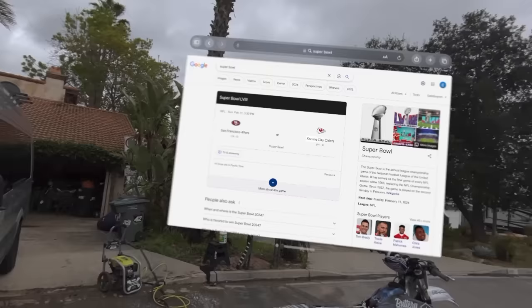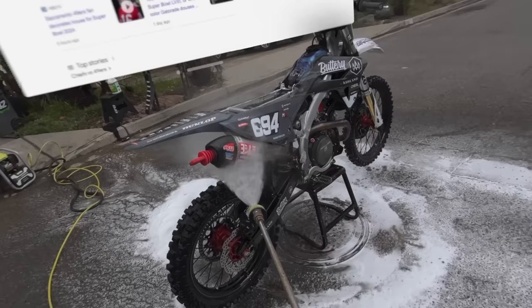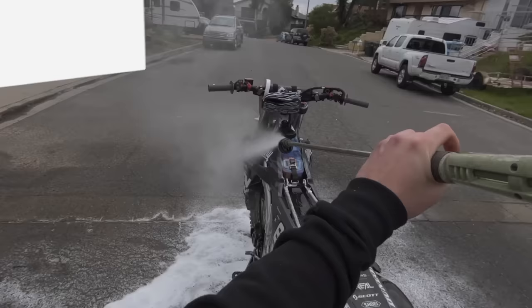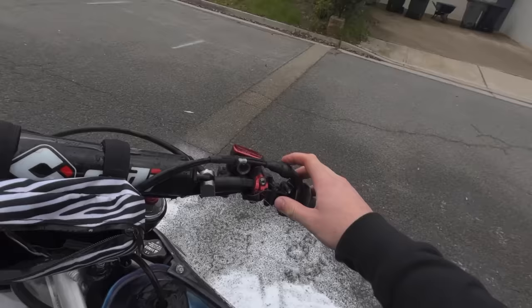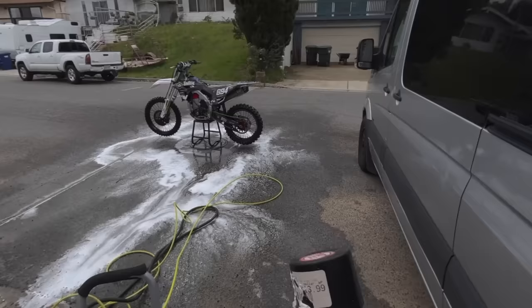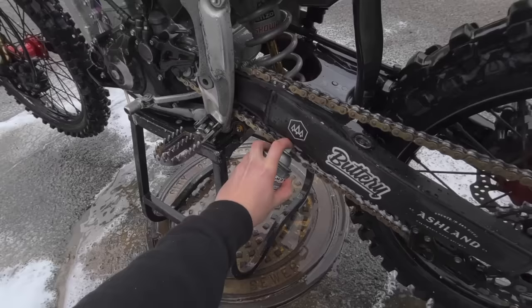49s for the Chiefs — what do you guys got? Super Bowl coming up two days from now, Sunday it's going down. Here's what I do — I always take the butt plug out. Some water builds up a little bit in between the pipe. Super major key right here — one of the biggest things that people slack on in moto: chain lube. Especially after a wash — you don't want that thing rusting out on you. I kind of get happy with it, I get some rotations, I'm hitting every link on there.